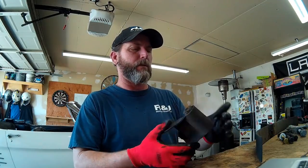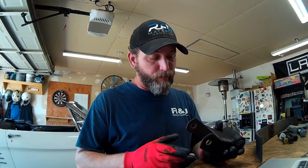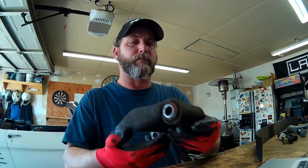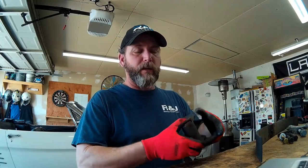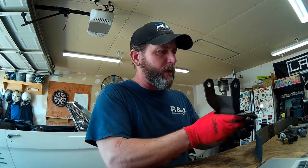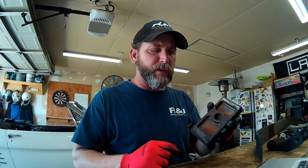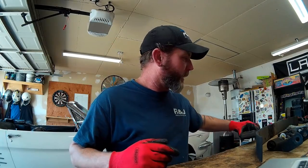The rear shackle has seen better days - the bushings are pretty well shot. Unfortunately I don't have new bushings right now to replace those, so I'm just going to run with what I've got. The rear springs aren't making noise and it's not busted all the way through, but it's pretty haggard. I'm going to chuck this up in the drill press and punch a 5/8 hole through both sides, then remount it into the shackle hanger on the frame with the open side facing the leaf spring so it can clear inside the shackle when it articulates. I was also pleasantly surprised that the overloads will clear on the Super Duty spring - I can just drop them on top, put the leaf spring on top, and clamp everything with the U-bolts. No new center pin needed.